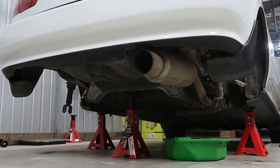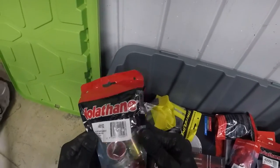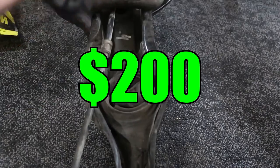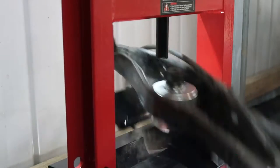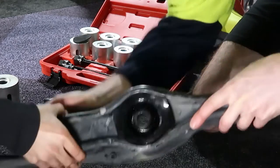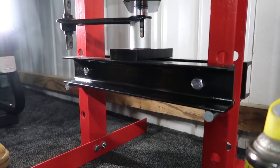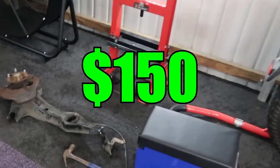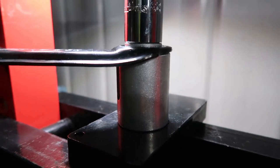Now with a blank canvas, I'm ready to install the new trailing arms, but before I do, I'm going to replace all the old rubber bushings, costing me around $200. Originally, I thought I could do that without a press, but that was not the case. Nowadays, you can find low-budget machinery which is perfect for small jobs like this. For $150, you get an upside-down bottle jack fitted to a metal frame, and with a bit of creativity, it works quite well. If you're a proficient welder, you can probably create one yourself.